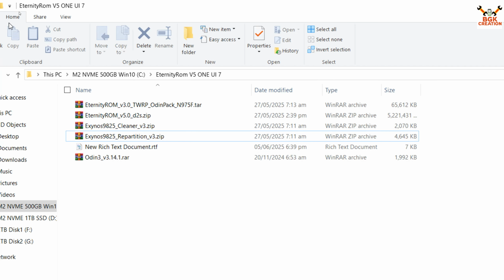So I am back to my downloaded folder. And one more thing, I have provided the Samsung Android USB driver link in my video description. If you do not have it installed on your Windows, then try to download the Samsung Android USB driver. Install it first on your Windows, so the Windows will detect the mobile phone. In case you have downloaded or installed it already, then there is no need to reinstall.